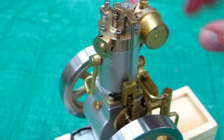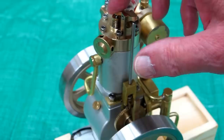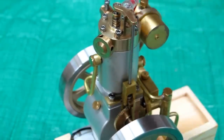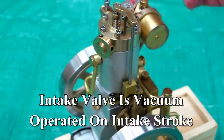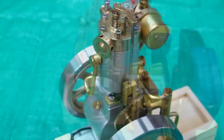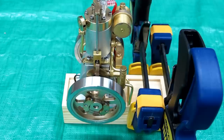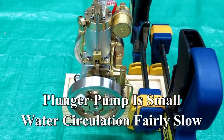I haven't put water in this yet, and this is just running in short spurts so it barely warms up. Keep in mind that all the time the engine is coasting, the exhaust valve is held open — air goes in and out of the cylinder, providing cooling. With the exhaust valve open, the intake valve cannot open, so there's no fuel going in. Now that it's running reliably, I'm going to put water in the radiator. Once it's running you can take the cap off occasionally to check the water level and use a syringe to add more drops.